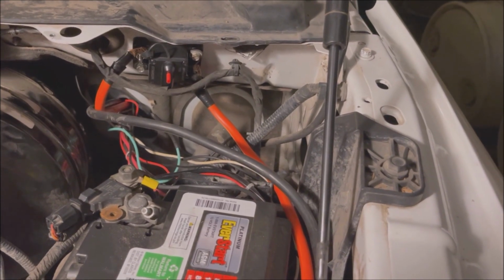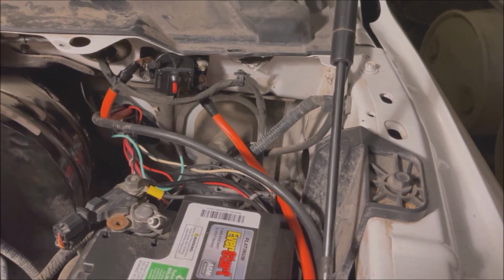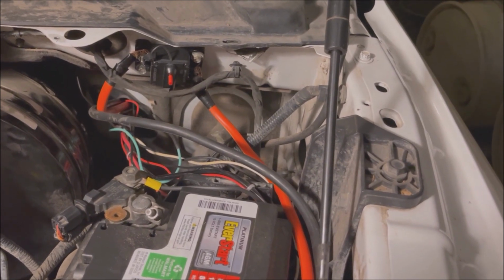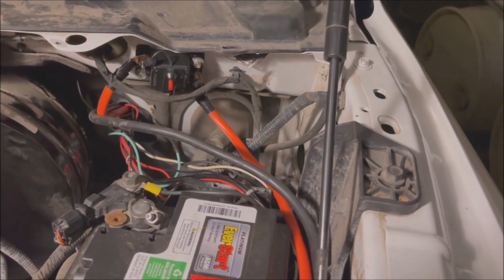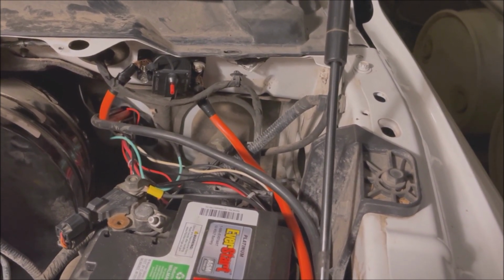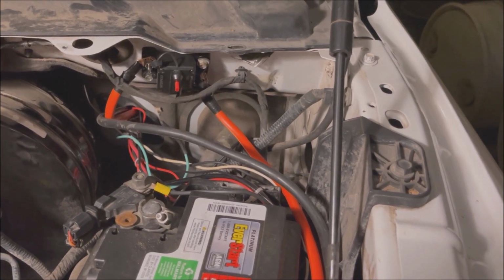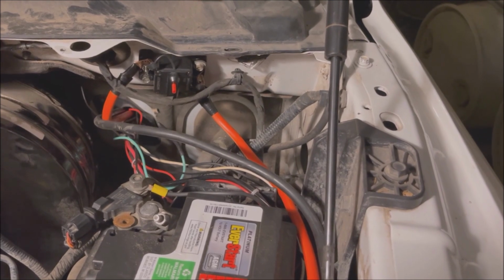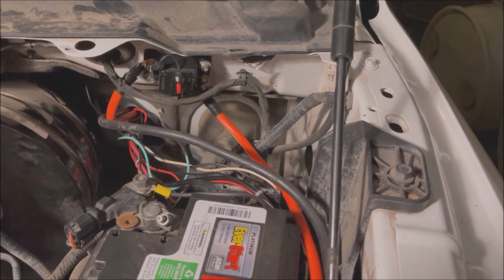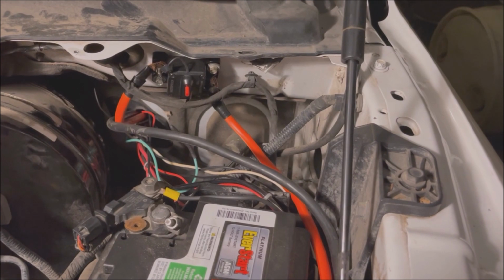On this battery cable, the closer the inverter is to the battery, the better off you are. Also, the shorter the cables are, the better off you are. You'll lose less power that way. Me, I wanted it inside because I'm not going to be running power tools or anything heavy on it, maybe a light. Possibly a coffee pot if there's a hurricane, and mostly just for charging phones and little things like that. So it's fine, okay?